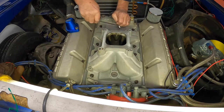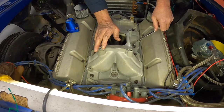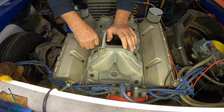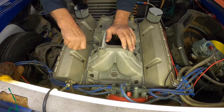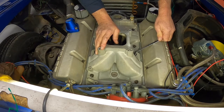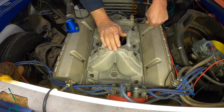But I'm not putting a tremendous amount of pressure on these. And I don't know whether if you wanted to put a torque wrench on them when I was done and go see what they might be torqued at. And when you go the second round, mm-hmm. It's not near as critical, the sequence. Okay. Because you pretty much have already taken any slack that is in there.